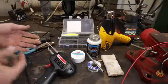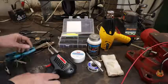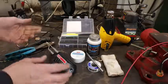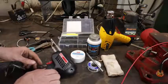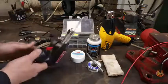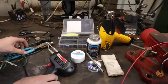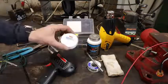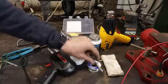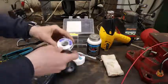You'll be able to repair electronics and different things that oftentimes we just throw away because it's not worth the trouble of finding someone to fix them. So just get yourself a soldering gun — you don't have to get anything fancy. These Wellers are good, probably in the $30–$40 range. You'll also want some rosin paste flux, a little brush, and some rosin core solder.